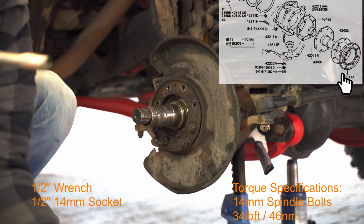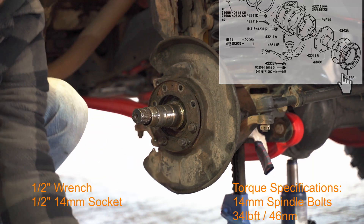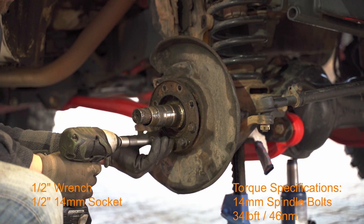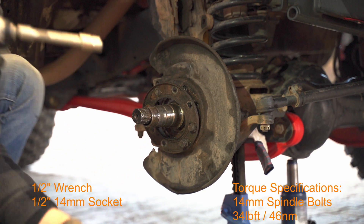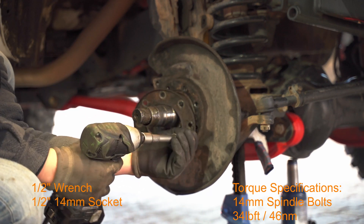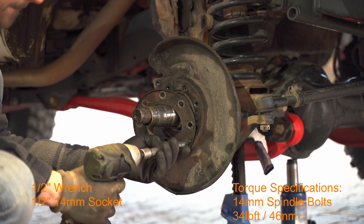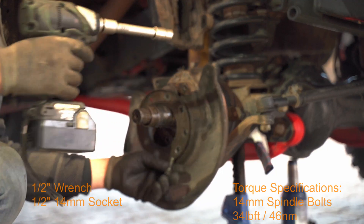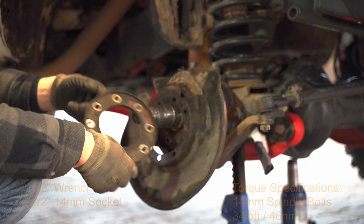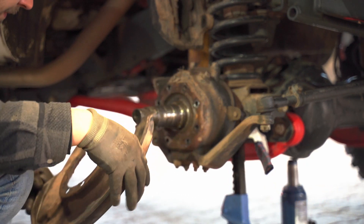This dust seal — I don't know why, but after about two years it becomes very brittle and not reusable anymore. I recommend changing it along with the other seals and gaskets. But if you have no alternative and you're in the middle of nowhere, learn how to restore and reuse parts to at least get you home. This was the seal, and this is the brake shield.